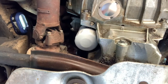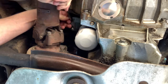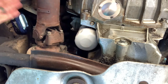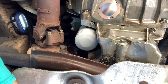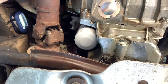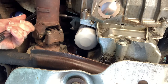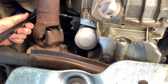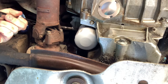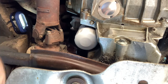I'm just a YouTube mechanic — I'm just messing with you guys. We're just going to snug that on both bolts. Now pull out the torque wrench. 87 inch-pounds — little click. And there we go. That is now changed out.